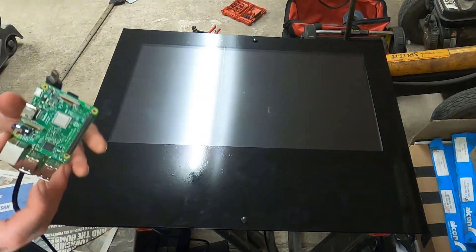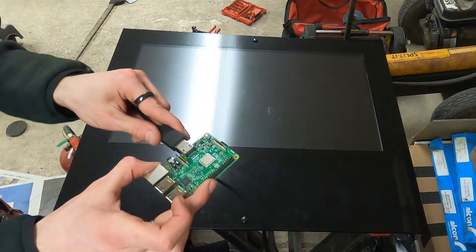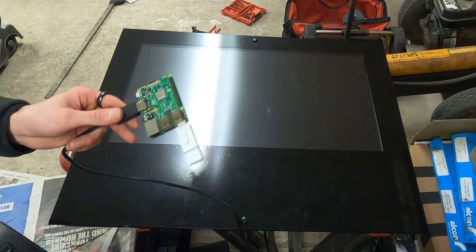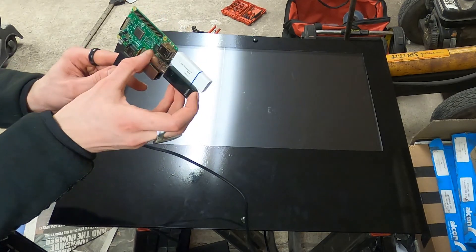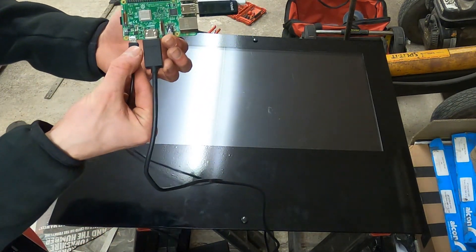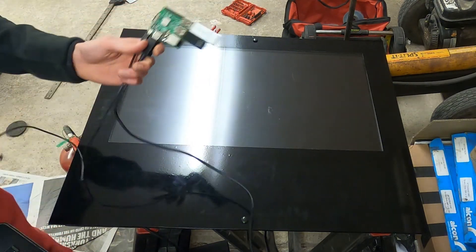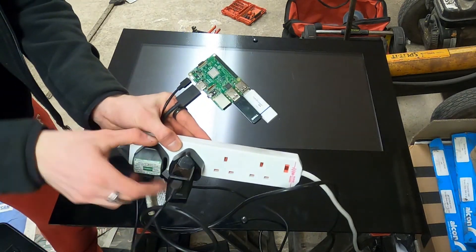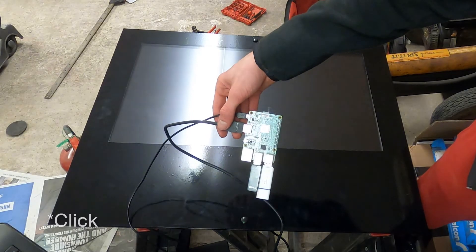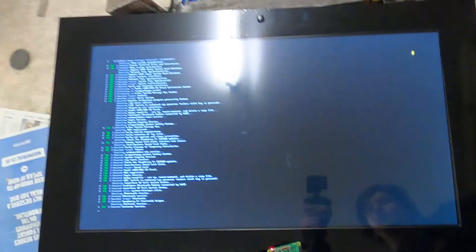I just want to show you a little bit of the basic electronics. So we have the Raspberry Pi with the micro SD card that we flashed earlier. We're going to plug the HDMI from the monitor into here. We're also going to plug in our USB stick full of games into one of the USB ports. We've also got a USB dongle — I'm going to just leave this in here permanently just to avoid any issues in the future; I can always plug the keyboard in and troubleshoot. Then the last thing we need is the power — that's just micro USB in the bottom here. The other end goes into a power brick, and that goes into an extension cable. You'll see any second now an LED will turn on on the Raspberry Pi — red for power and then green probably means it's booting. Should see loads of stuff flash about on the screen as RetroPie boots up.